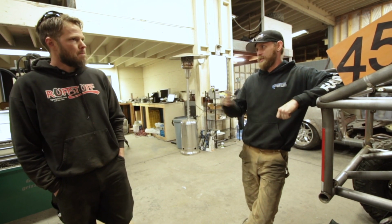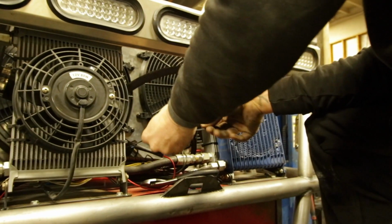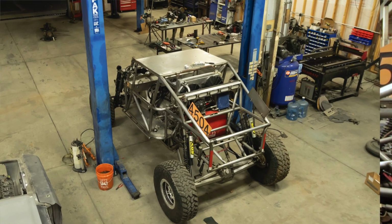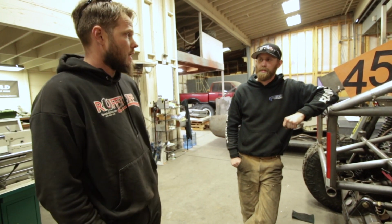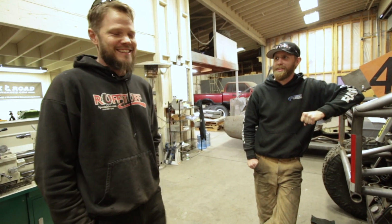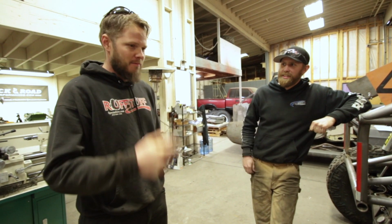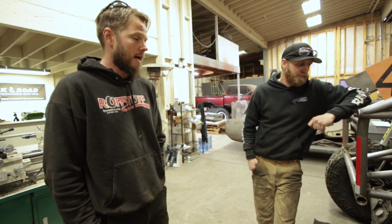We were fighting overheating throughout the season. Yeah, throughout the season. We modified our radiator, went to bigger fans, went to a high amperage and high output alternator. We fixed that issue. We are also, during the Stampede, we also had a backyard modified transmission at the time. We were flipping switches to get it to shift. Still has automatic valve body. Yeah, and I rigged up a few things to make it work, and you know what, it did work for what we had.